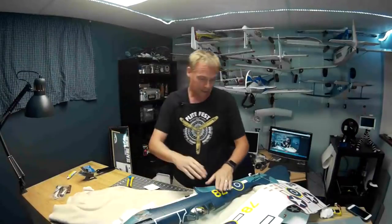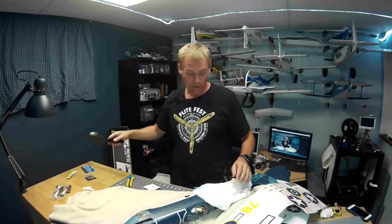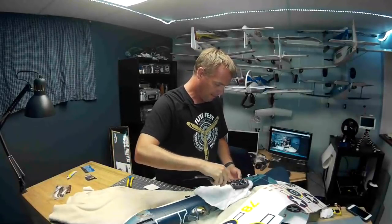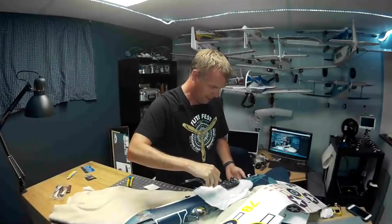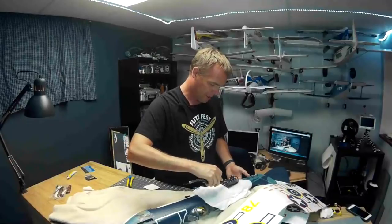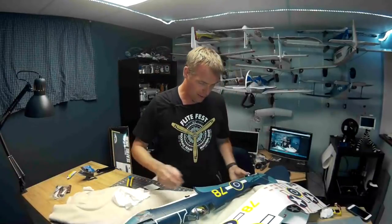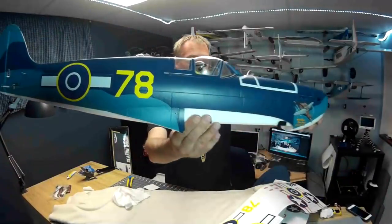Cool. It's pretty painless. All right, a little bit of heat. I do like the white cloth because on most aircraft you can see through and you can see where you're working. And then unlike the boot, you actually don't run the risk of touching anything extra. So I don't think it takes a whole lot to lock them down. It is something you want to watch in heat, the really warm days flying. I've had a few of them lift up. And so you just simply come back and reapply a little heat and they seem to sit down nicely. There we go.